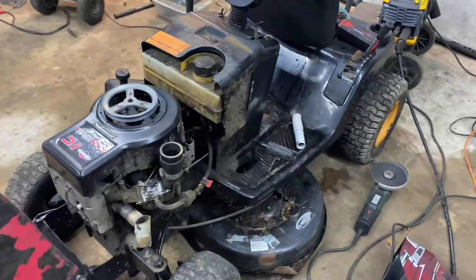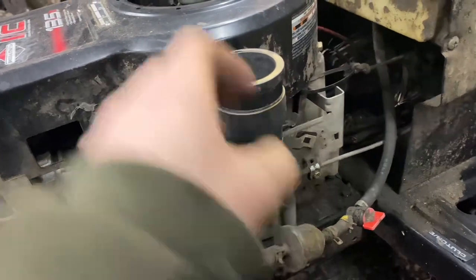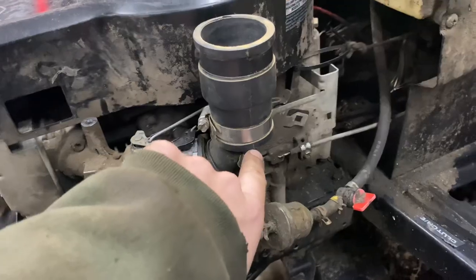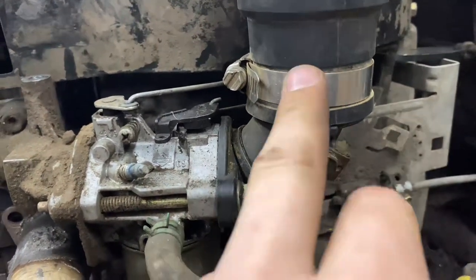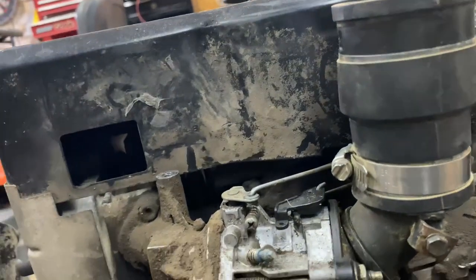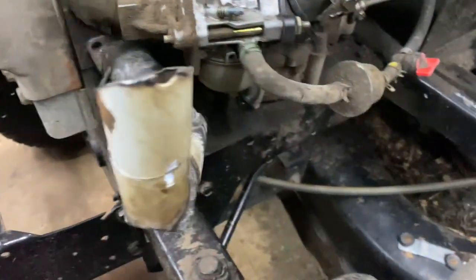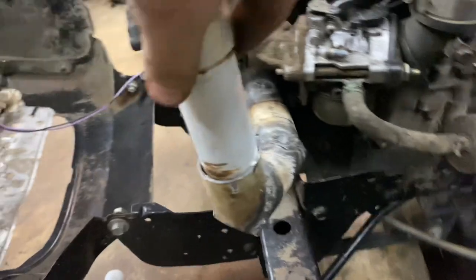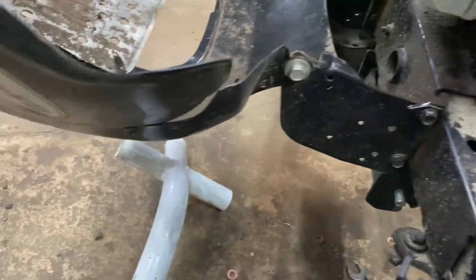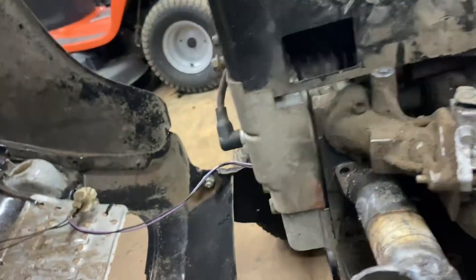I've made a lot more progress. For my intake I have an adapter and then the Briggs & Stratton 90-degree intake piece off a Briggs Intec — the carb 90-degree fitting — and it goes up to this adapter. The turbo is going to sit on this exhaust flange that I've made, but I have to cut it because I made it too short — it needs to be about half an inch higher. So this pipe will slide into here, and then I can slide the angled piece on top of that to get my distance.